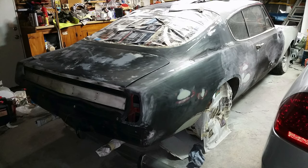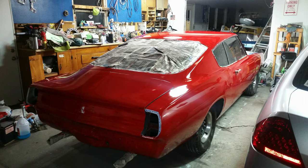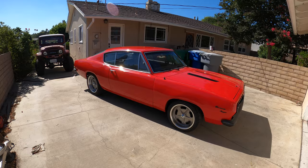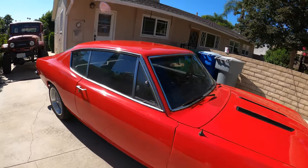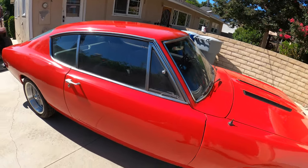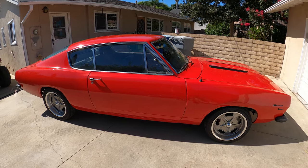Again, since I was doing this on a budget, I used boat paint and rolled it on. So it was an interesting adventure. I read on the forums which type of paint to use and rolled it on, and from 5-10 feet away, the car looks beautiful. Once you go in closer, you start to see the imperfections of the paint. I'm not sure you can capture that on camera, but there's some little water or orange peel type marks.